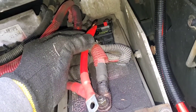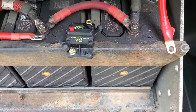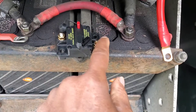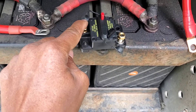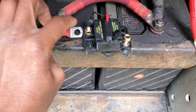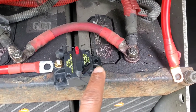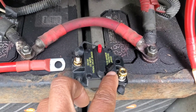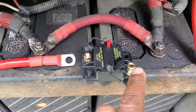So I'm going to wrap this up and put it right here. Now I'm getting ready to connect the breaker to the wires. This is the wire that goes up in the cab. Pay attention to the labels on the breaker — this terminal is for the accessory, which is the wire going up in the cab, and this terminal is for the battery wire. Also notice this breaker is tripped — you need to leave it in this position while doing your wires.